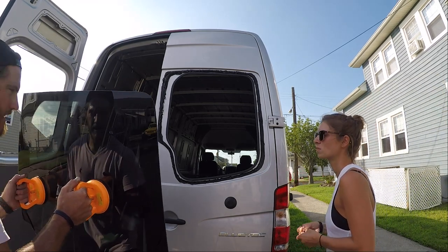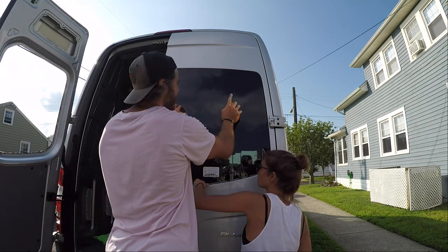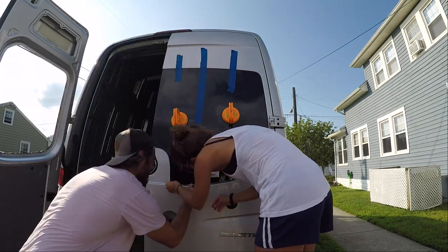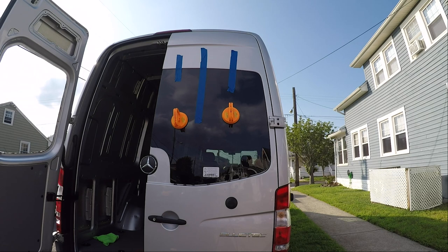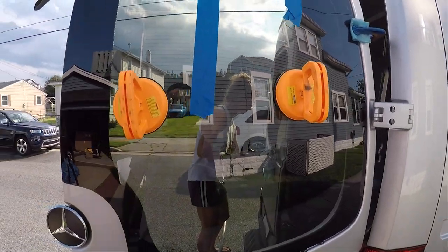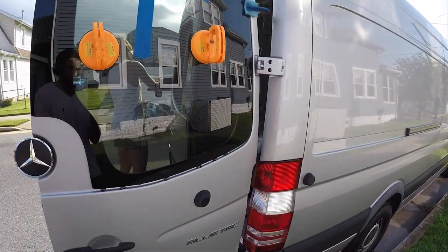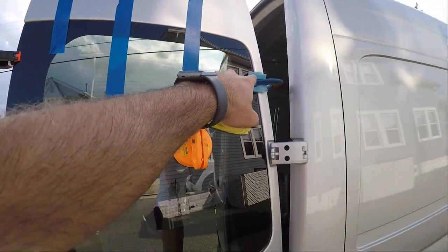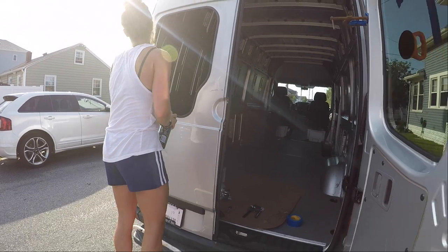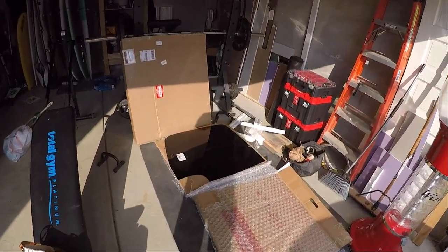When you apply the window to the urethane adhesive, we use suction cups to help move the window into position. We have little spacers underneath the window to prevent it from sliding down, and we tape the top with masking tape to make sure it stays up. These suction cups are from Harbor Freight — about eight bucks — and hold up to 80 pounds each. We've got the C-clamps on to keep the pressure while we work on the other window.